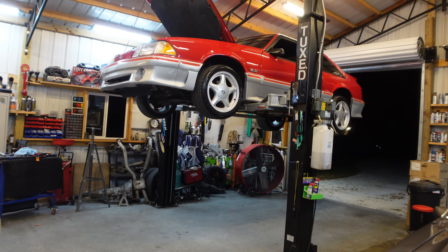So let's go over this again — this is two and a half inch, so I made a mistake and grabbed one of those flanges. We got Hunter here by the way. As you can see, this flange is way bigger than the other flange — it won't even line up. That's what's going to make this car sound unique in my opinion — all this Frankenstein exhaust. Think about it, the retro fox is Frankenstein as hell but it's one of the better sounding cars that I've got. I think with the three inch flow tubes and the Jones mufflers this thing should sound pretty good — and hey, it might not sound any different.